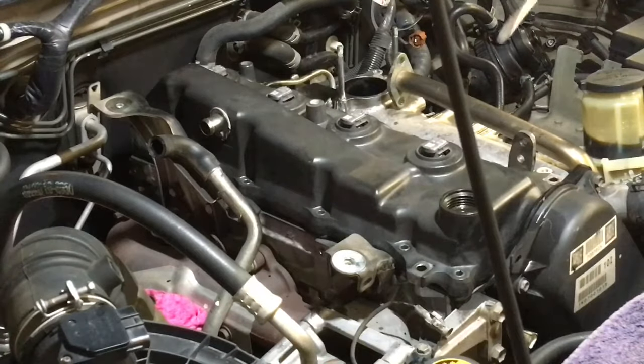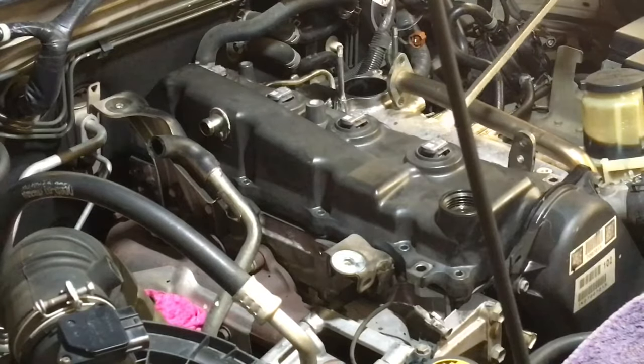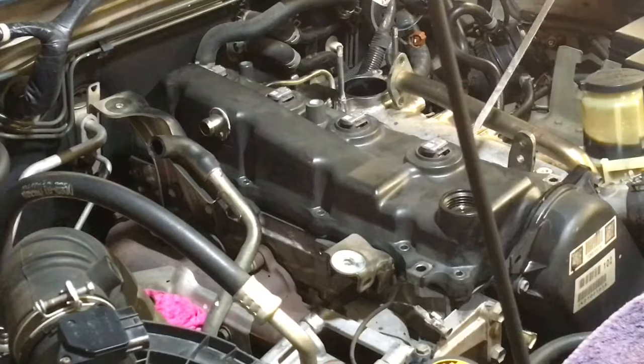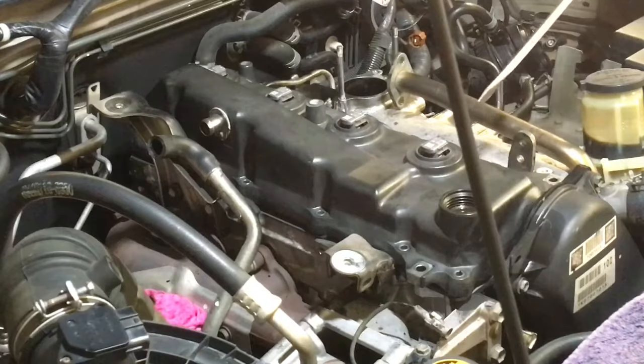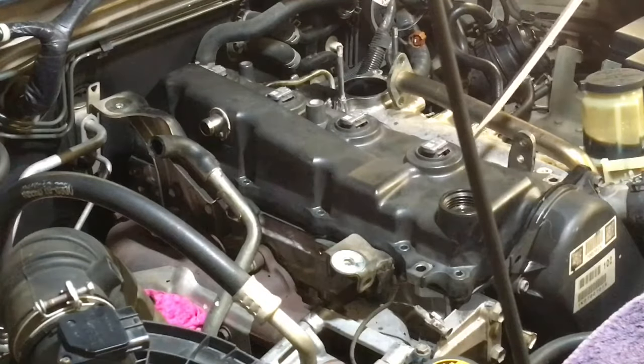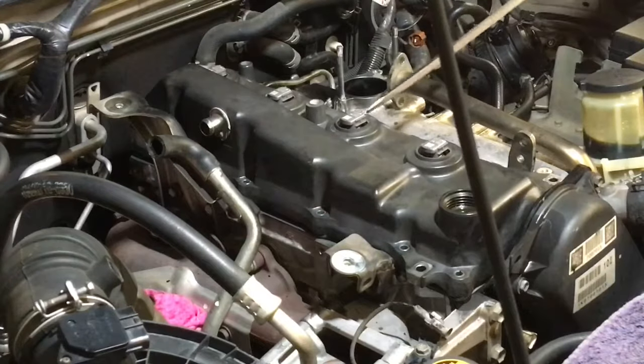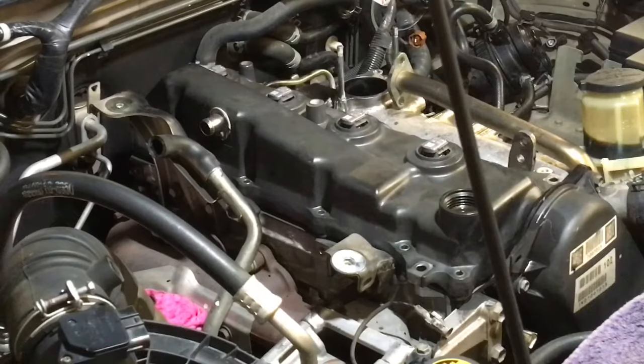Because everything's loose, it allows the angle of the injector to move a little bit, and obviously you get your leverage from doing it here. I'll just give it a little twist. It's only pushing on the red cap and the inside of that hole. It's not going to damage anything. It's just cast plastic, whatever. So that alignment's all perfect.